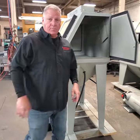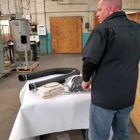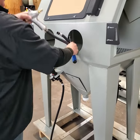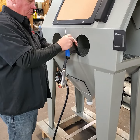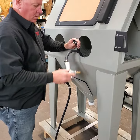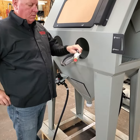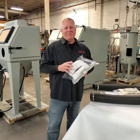Here's where the hose clamp from earlier comes into play and we'll use our flat-head screwdriver again. These clamps must be installed because this is a compressed air fitting and you don't want the hose blowing off the back of the gun. Make sure the clamp is on the hose, push the hose onto the back of the gun so it seats, and then tighten that clamp.